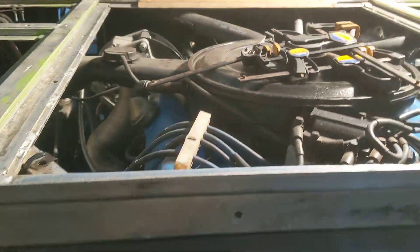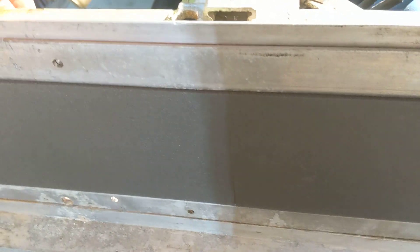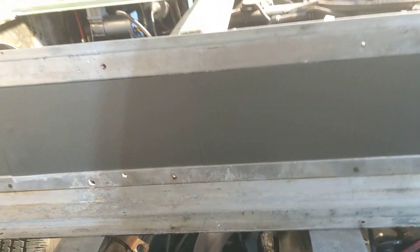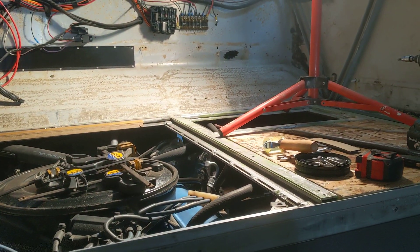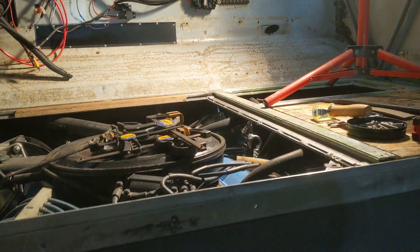There was a slight recess in this aluminum panel and it was full of holes, a lot like the front of dash. Those holes were from some factory stuff but mostly aftermarket add-ons — their fire suppression system and the way they routed wiring. So I wanted to block those holes off. This is a self-adhesive backed insulation, not foil faced, just a rubber face. I bought it to do up the front of dash to seal up the little holes in there.